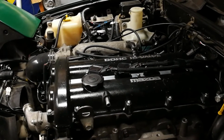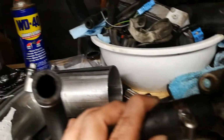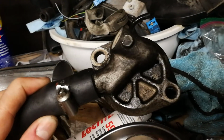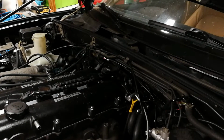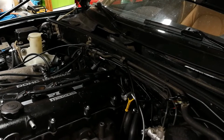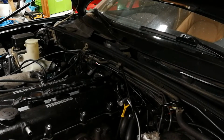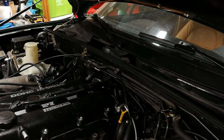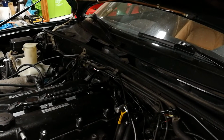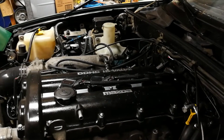At the back of the engine, you're sort of limited in flow to a much smaller hose that goes to the heater core. In a Miata, many people feel that the heater core, which runs your heater and everything, is actually an extra piece of the cooling system, which is not normally the case in a car. It's sort of an add-on that you use to heat the cabin, but it's not really a critical part of the cooling system. It provides an extra little radiator, almost a heat sink, for the coolant flow out of the back, and it sort of helps with the temperatures for cylinder 4.